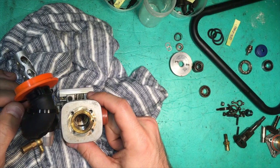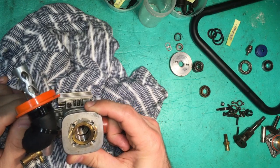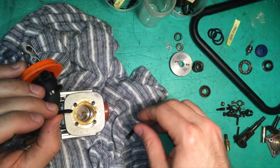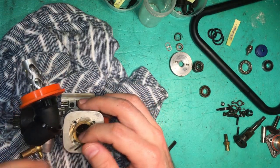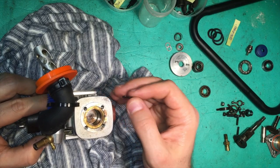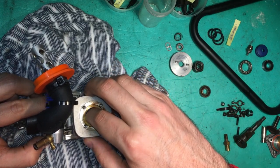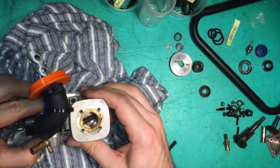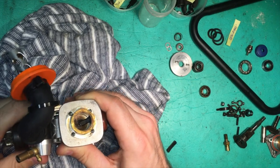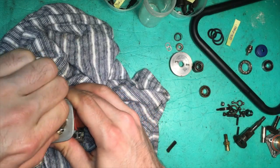First thing we've got to do is lift the sleeve up while we've still got the flywheel attached. So what we'll do is block the exhaust port from the inside using a couple little pieces of zip tie, and we'll see if we can raise the sleeve a little bit. So what I do is I rotate the flywheel until I've just got a little bit of the exhaust port exposed, and then I'll rotate it, see what happens. Okay, there you go. Boom, sleeve came out. So that's just using one bit of zip tie on the inside.